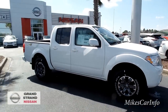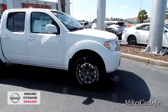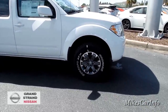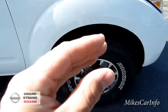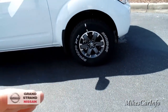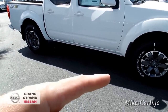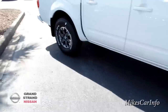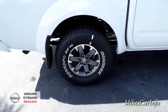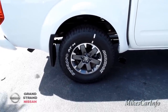This one has the four-wheel disc brakes. On a regular car, you typically only get ventilated disc brakes in the front — where the disc has a space that allows air in to dissipate heat — while the rear just has a solid flat disc. But on this one, it has ventilated disc brakes on both the front and the back, so the brakes have the ability to cool off during off-road conditions.